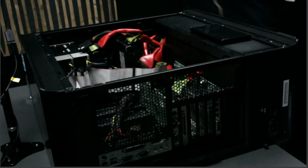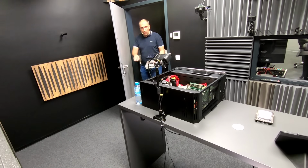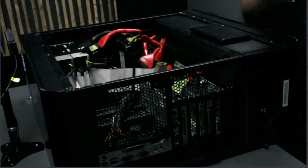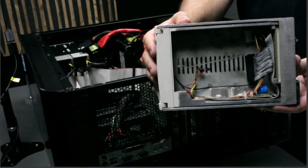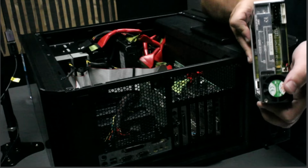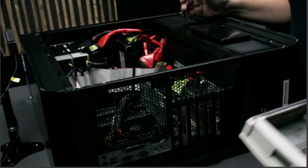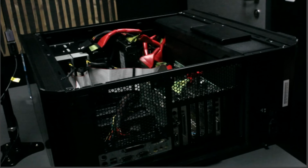And actually, just 1 second, in the future I will upgrade this case a little bit, modify it, so that the discs are inside a dedicated SCSI disk caddy, because it has a cooler in the back end, so it can cool the discs. These are all, I think, 10K, if I remember correctly, so they tend to get quite hot. Let's call it that way, because that's actually the way it is.